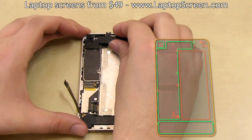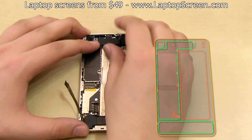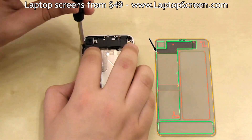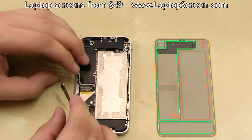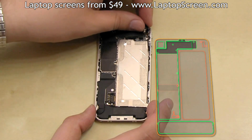Then replace the top fastening shield — it needs to slide from the bottom in order to catch its mounting bracket. Once the shield is properly aligned, replace the five screws holding it in place. Then reconnect the middle connector, which ties in the docking port to the motherboard.